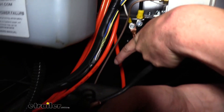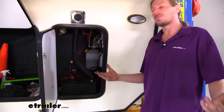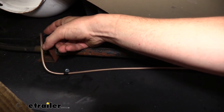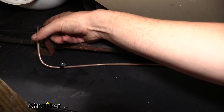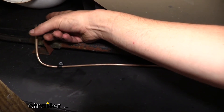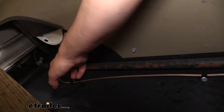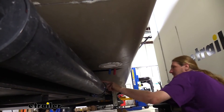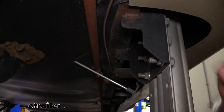Our line goes down and then out a hole that we had drilled right at the bottom, and then we head outside and start routing it towards the back. For reference, we are starting in our front compartment because that's where we mounted our actuator. This is where we pass through the hole we had drilled and come down. You'll notice there's a little piece of rubber here — this is just some rubber vacuum line. It's great for wrapping around brake lines anywhere you're suspecting it might rub against metal and potentially cause an issue. We just slit it to open it up and wrap it around there, using a zip tie to keep it in place. From here we just go around our propane line and follow that propane line all the way back, because it's already routed in a way where we know it's going to be avoiding any moving components. We just stay right underneath it using the included clamps and self-tapping screws to run it right into the frame, continuing along next to our propane line.